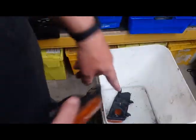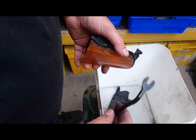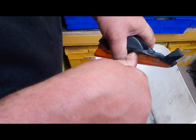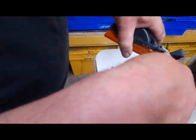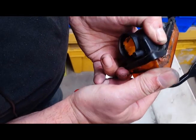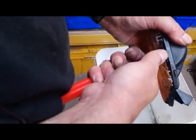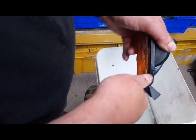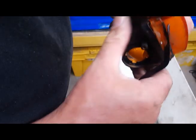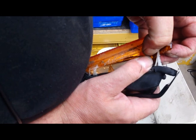Just got the lens out of the hot water — you can see the other one still soaking. Now we need to soften the glue up. I like this tool — it's actually a panel removing tool but it's really good for spreading the load, because the last thing you want to do is break the housing. You can see the lens is coming out and the old glue there. As you get so far you can then prise it apart, just running around breaking the glue.